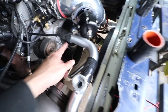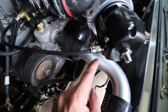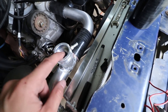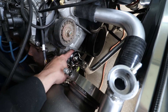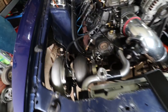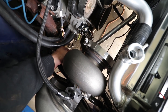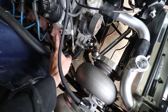So this is essentially what's going to be here. I did use a piece of smaller hose because it was a tighter fit on the neck, which is slightly smaller than this 1.5 inch. So I have to get some hose clamps for that, need to get the radiator cap — I was going to steal the one off the Civic but I forgot to grab it. And then I need to get some RTV for this because there's supposed to be a gasket, as well as our thermostat. We did get a Mishimoto 170-degree stat. With that being said, we're going to pull our wastegates off and pull the turbo off so we can get this gasket in here to make sure all our exhaust leaks are sealed up. There are no springs in the wastegates right now, and we have to put the other lube in.